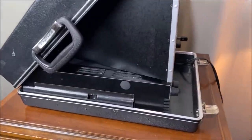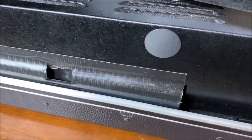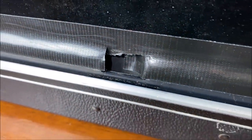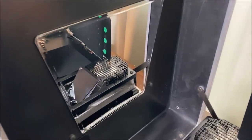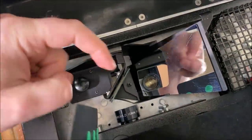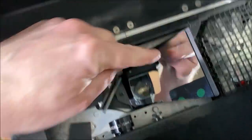The left side is equally boring. Notice there's tape going across here — there was tape there originally as well, perhaps blocking light that may leak through this part. There's also a little notch where the top of the lid fits in. Lifting up the lid, you'll see on the back we have a mirror, and the mirror projects the image. This lens right here is what's actually projecting the film — it hits one mirror, which then hits another mirror, which then hits another mirror, which is transmitted to the back side of your screen.